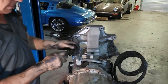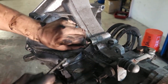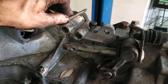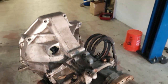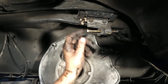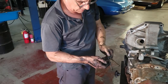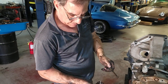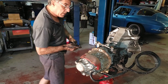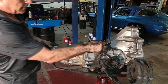Here's the upper mount — the bolts go right through and are held in by the casting. If you look you can see the hex. These bolts come all the way through that mount, and the nuts and washers are over here. There are two different bolts and this one is not correct — we'll get the correct hardware. The backup light switch wires just got disconnected as well.